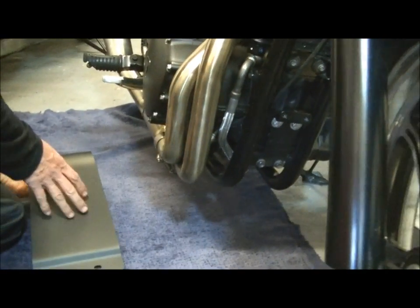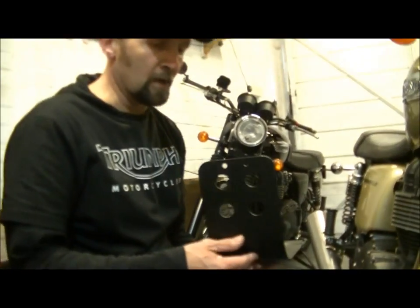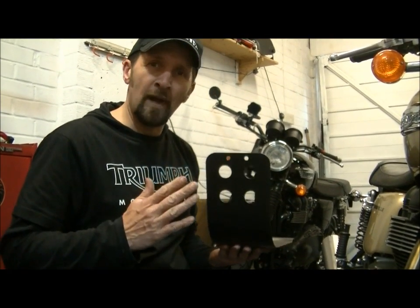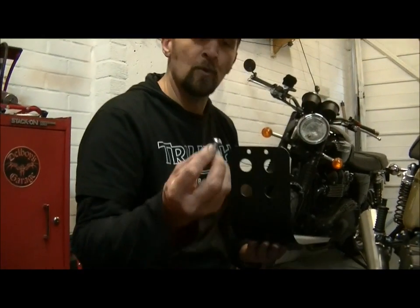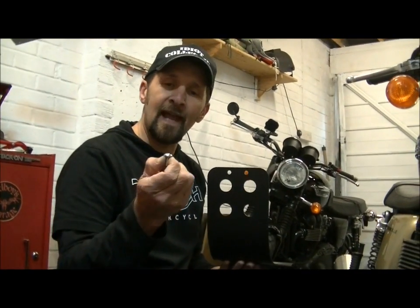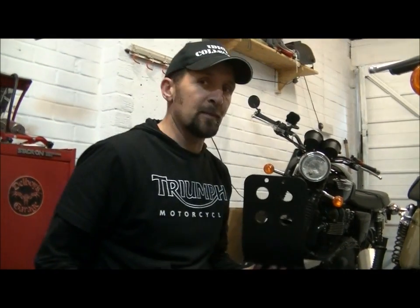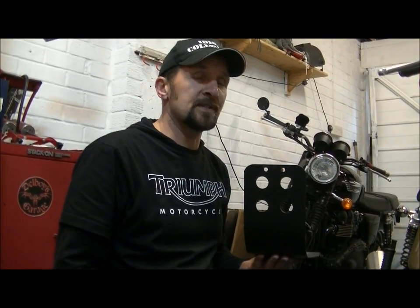Now one thing I will say, my friend Alex said a little while ago, because he's plastic dipped his whole bike, or the bodywork on his bike, and he found that when you bolt a bolt into a piece of bodywork that's been plastic dip sprayed, or even new paintwork, just regular new paintwork that's still soft, if you put the naked bolt straight in, as it goes right home and you tighten it up, the back edge of that head rubs against the paint and it turns in a turning motion and it will twist. I saw a photograph of Alex's bike where he'd done a bolt up, it had twisted the paint in a horrible little twist, and I think a few of you might have seen that on decals as well.